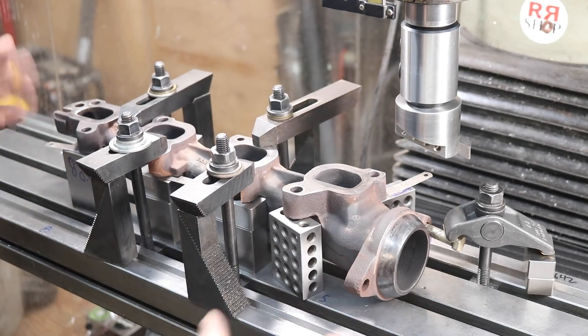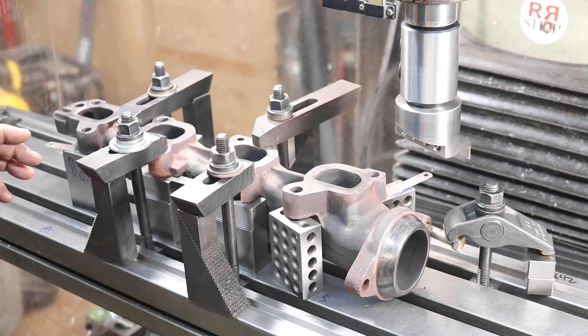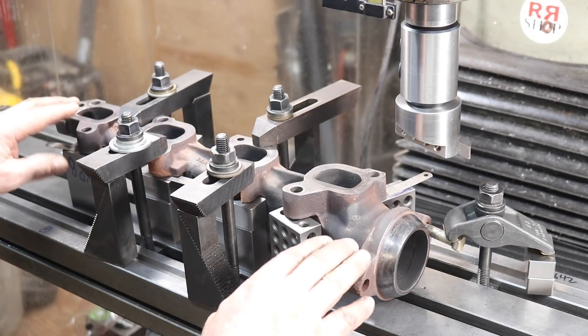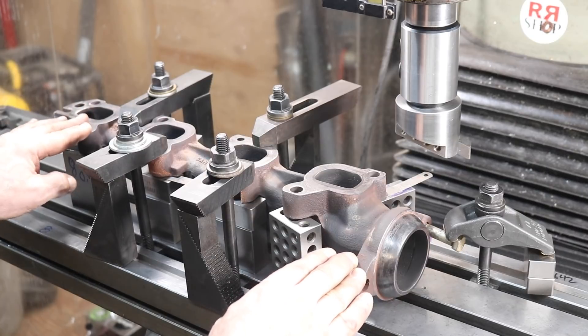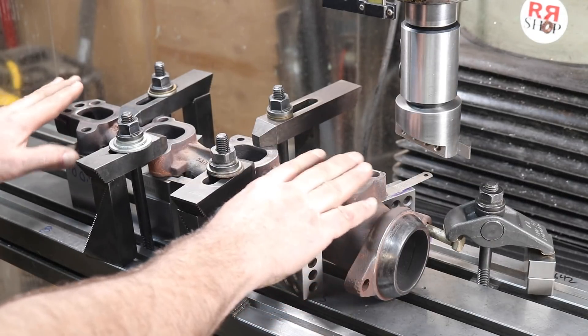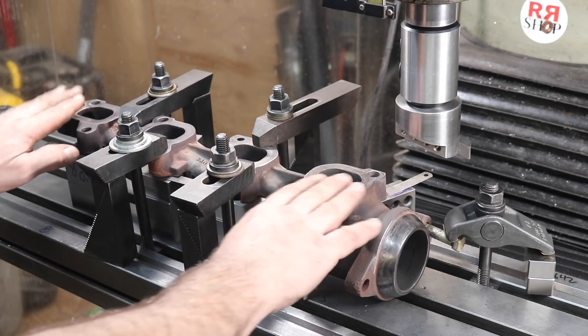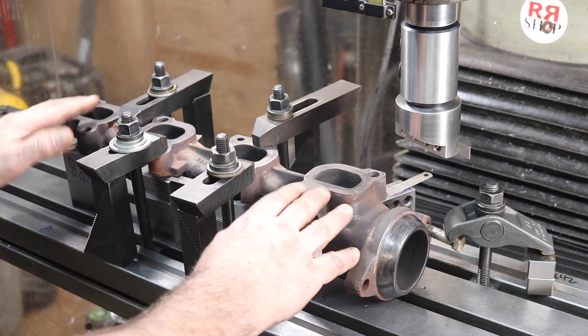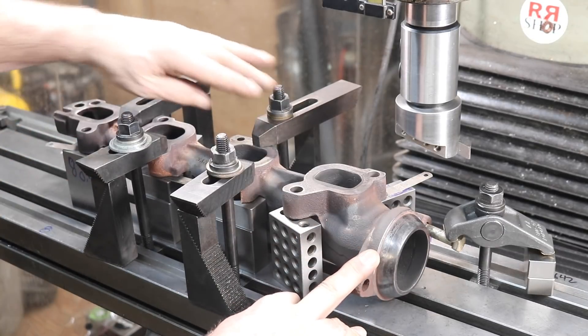This is the exhaust manifold off my truck. Over time I've had several broken studs — dealers fixed it under warranty — but now I've ended up with another exhaust leak and another broken stud. We got the stud out and helicoiled it, so the truck side is fixed. But the real problem is this manifold is so warped: it's high in the middle and low on the ends. The two ends are about ten thousandths difference, and in the middle we're talking another 37 thousandths. That's why it keeps breaking studs. I'm going to mill it.